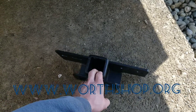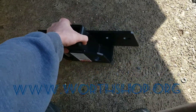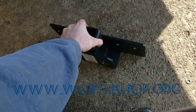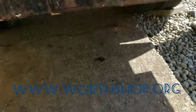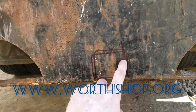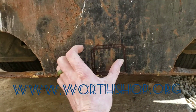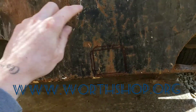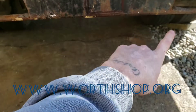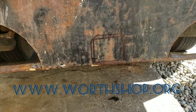I grabbed this at Harbor yesterday. I figured it looked like a pretty good starting point for a trailer hitch. It's already got the safety chain thing and the trailer hitch part. My plan is to cut a square out here and then put this in from the back side, with just that little square part poking out so I can weld along this and along wherever the upper one meets up here, and along the bottom. I'm hoping to make it pretty strong.